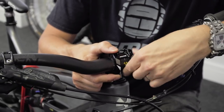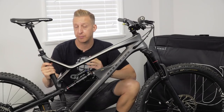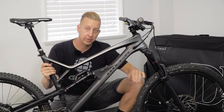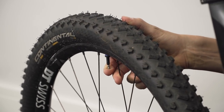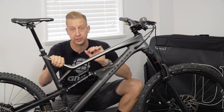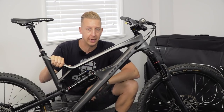You're going to need to disassemble quite a few bits on a bike before packing it away. There are also a few other things to consider, like letting some air pressure out of your shocks and your tires. I've traveled many times having not done this and it's been no problem, but some airlines do request that you do. Letting a little bit of air out of your tires is no harm — it's easy to reinflate — but I do recommend not going completely flat, especially if your tires are set up tubeless. As for your shock and fork, just note that air pressure before you do so, jot it down, and keep that bit of paper inside your bike bag for reference.